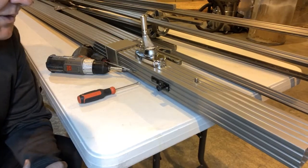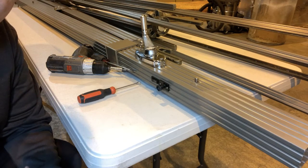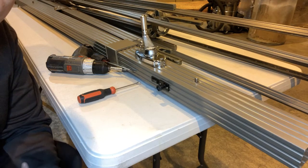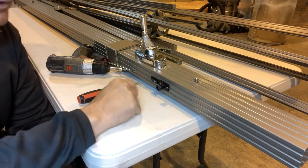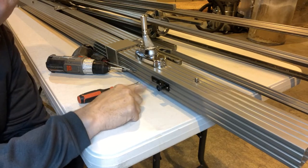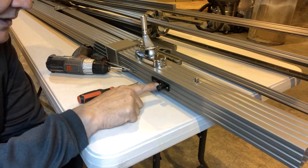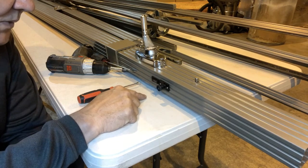Now that we know we have a good transformer and we've checked those three wires underneath the small canopy up on top of the umbrella and they're pushed tightly together, if you still have no lights, the next place we're going to look is at the light switch or the socket here. It is possible one of the wires just popped off the back of the switch, or maybe even the main brown wire is disconnected from the socket red wire.